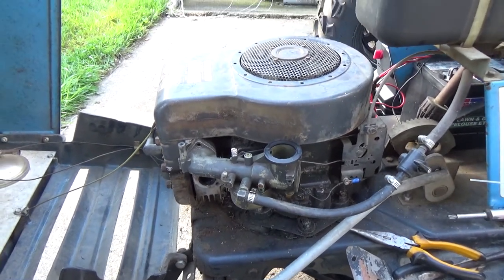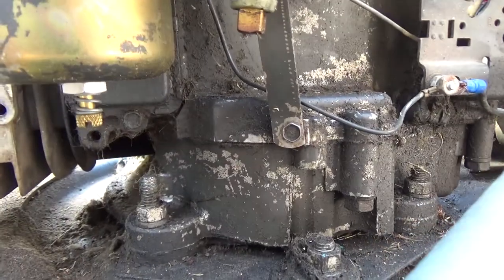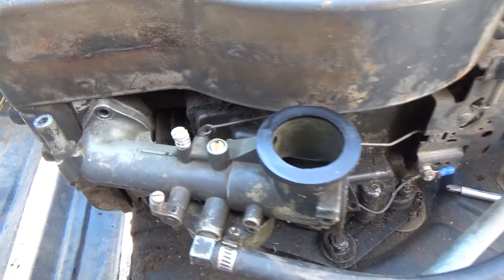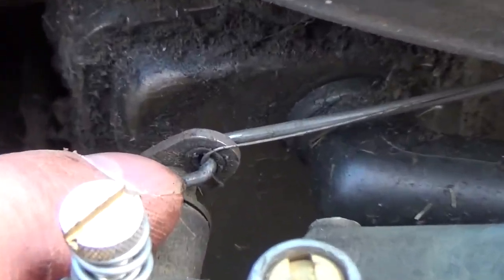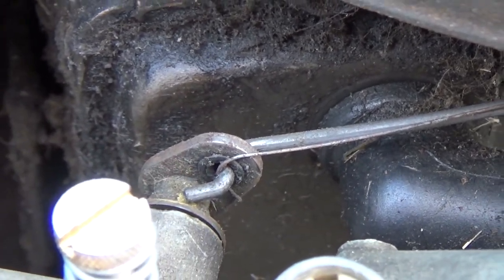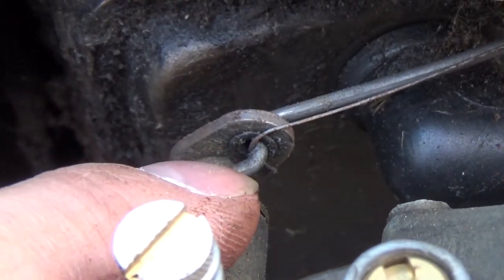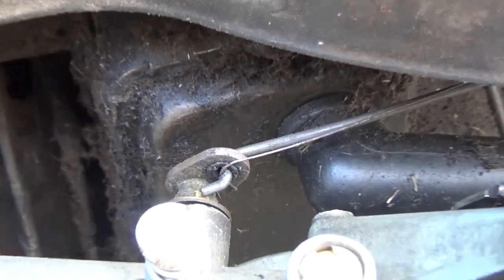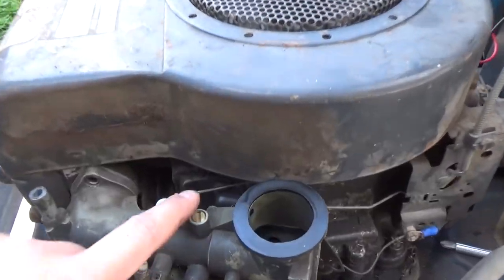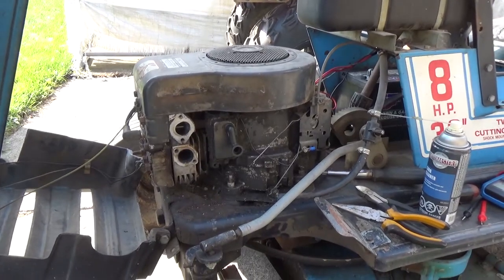With both bolts out of the intake neck, there's one more bracket bolt and then we disconnect the fuel line. I want to show you that there are little plastic pieces inside the throttle where the linkage connects — don't lose those, because they're super hard to find. On a lot of these old carburetors the holes on the throttle levers are bigger than the linkage, so they use those little plastic sleeves. We then disconnect the spring and linkage, rotate the carb off, and we're ready to clean it and flush the fuel tank.